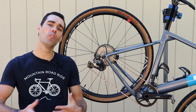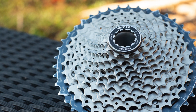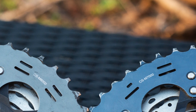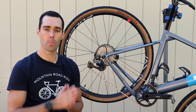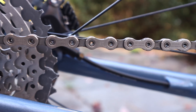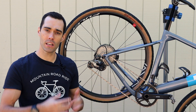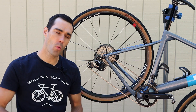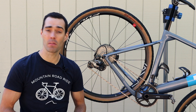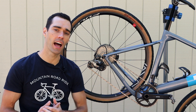To try and overcome this, I opted for better components. My previous cassette was the Shimano SLX m7000; I upgraded to the XT m8000 cassette. The logic was that better tolerances within those components might handle the extreme chain angles better. Along with that, I also went with a better chain — upgrading from the mid-range chain to the XTR chain, really splashing out on higher-end components. The result? It really didn't make much of a difference. I could not see any noticeable improvement in those inefficiencies when running cross-chaining gear combinations.